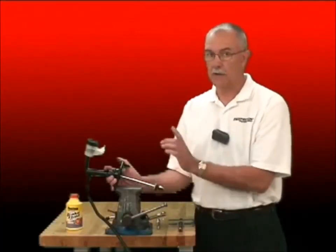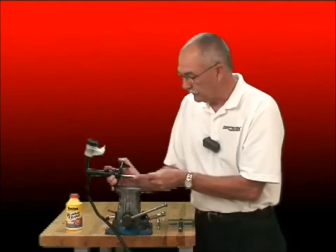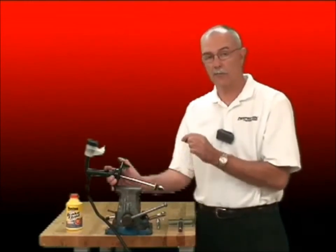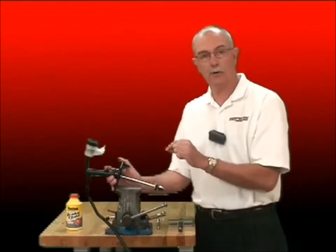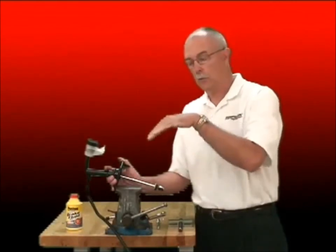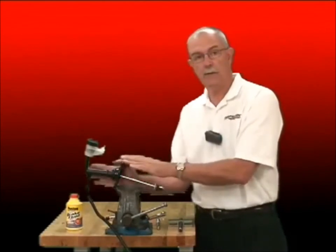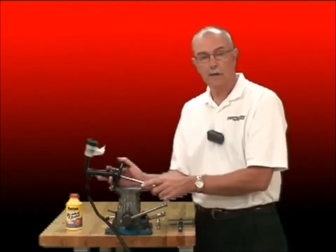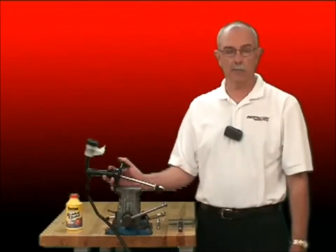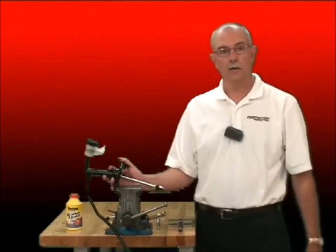We just finished bench bleeding this system — it's a lot easier on the bench. You can see the entire system without working around the vehicle. As you push on the pushrod, look at the master cylinder piston assembly: less than one eighth of an inch of travel before the system goes hard. One thing I want to point out: the orientation of the line the whole time — it was oriented so that an air bubble could go up and out, with no air traps. Even the master cylinder is tilted from horizontal, with the reservoir end tipped up so air can escape. If you have any questions about bleeding a hydraulic system or clutches or flywheels, please call Perfection at 800-258-8312, press 4. Your call will be routed to Tony, Steve, Bobby, or myself.